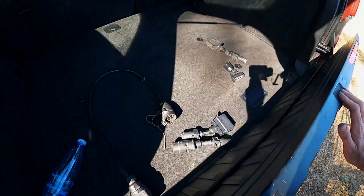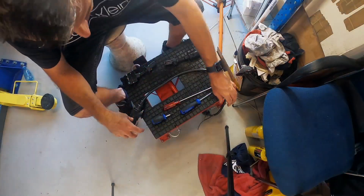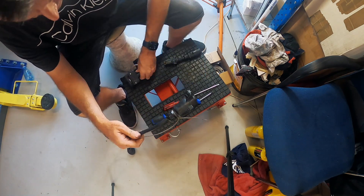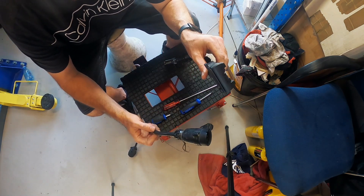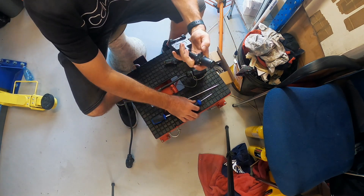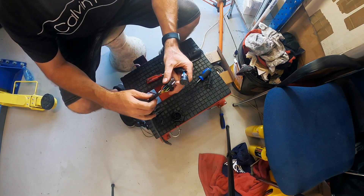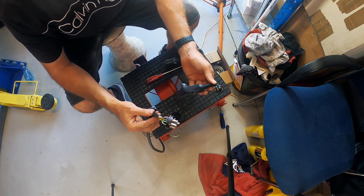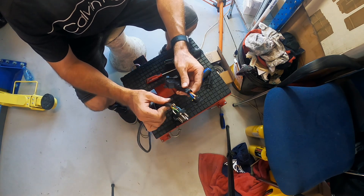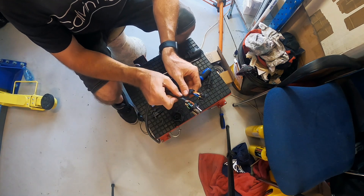Now I've got to work out how to cross-breed these two things. I think what I'm going to do is actually just cut into the genuine trailer connector and try and wire on my flat pin. So let's get them taken apart and see what they look like inside. I've got both ends — 7-pin small and 7-pin large — and I wanted to see if the wiring colors sort of match up, and it looks like they do.